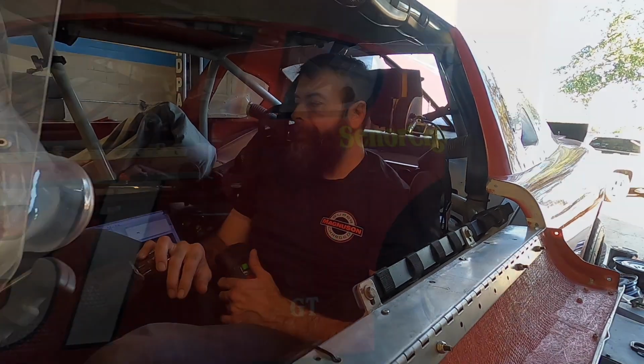Well, we made a little bit of progress here. I think we made 486 on one of the previous pulls, just tweaking the timing and the fuel ever so slightly, but my hands are really tied with some of the data. It's a really old processor, and I'm not getting very good data out of it, but I'm doing the best I can. So let's keep going. I'm sprinkling a little timing at it, trying to get that air-fuel right. Go.